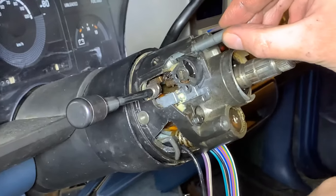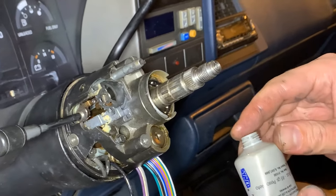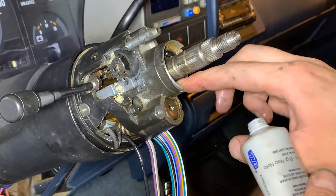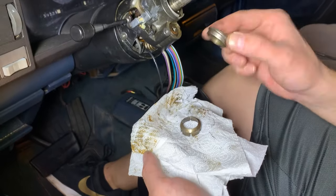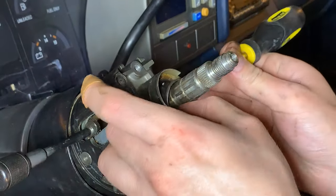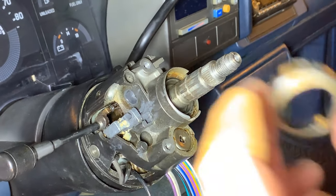We've got this back together with the steering wheel lock pin back in as well. On the bearing itself I'm going to add just a little bit of fresh grease before I squeeze the race on — you could even add it to the race and then squeeze that in as you put it back together. Next up we've got our bearing race and dust cap that go in the center. There's the bearing race — slide that in using a small flat screwdriver to get it in there. It comes right in there next to the bearings, then we'll put our dust cap on.